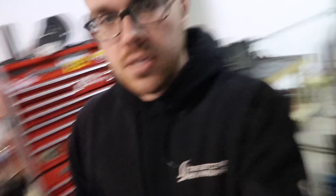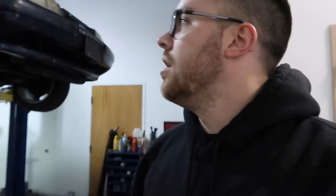It does have coilovers in the front. One of my favorite parts about the car: the 17 pony wheels. Now one of the things you guys are probably going to like, or we'll get some criticism on, is that this is a '90, so it was originally an EFI car and it has been swapped to a carburetor. My car was a '91 and it was also swapped to a carburetor. The benefit is that this car is going to be set up with the fuel system off of my car — the fuel tank, fuel lines, fuel regulator, and regulator to carb lines. He got a carburetor very similar to mine, so we're going to reincarnate that. There's also a wiring nightmare on it we're going to address as much as we can.